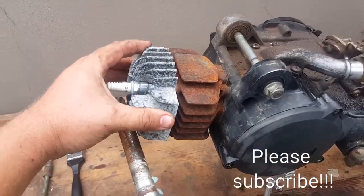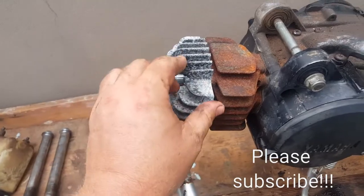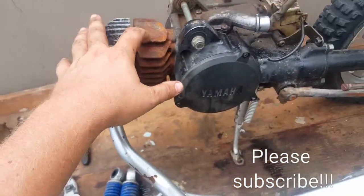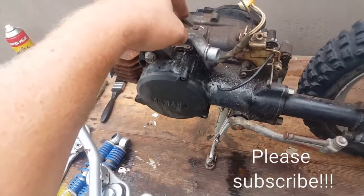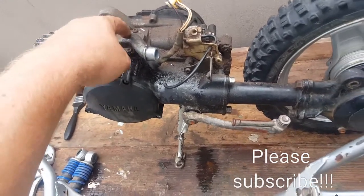The engine is also not in very good condition. All this will have to be sandblasted and high-heat black — maybe spray paint rather than powder coated. The reed valves have opened up; I've checked and they are flat, so I don't think I need to replace anything there.